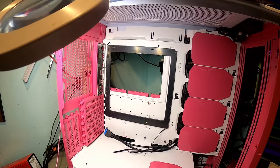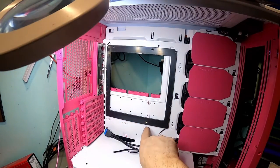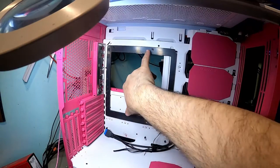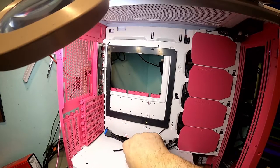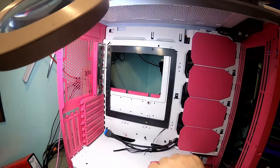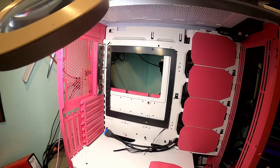I don't really use them that often in black cases, but I do use them in the white ones, especially on motherboards like the Zaku that don't have RGB around the perimeter like some of the higher-tier boards would have. It's just an easy way to replace the RGB. It's really easy to do — as you can see, it's sitting right in there with holes cut out for where your motherboard goes. Your motherboard just sits right on over it, and it kind of protects the board a little bit — you've got a plastic boundary instead of banging on the metal. So I'm going to go ahead and put the motherboard in.